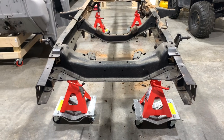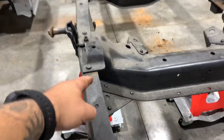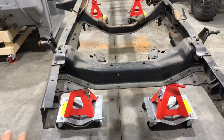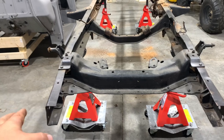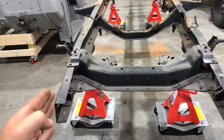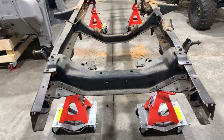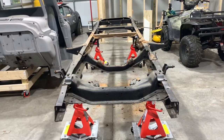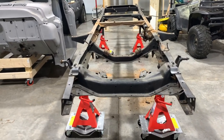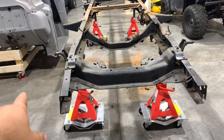Here's a better look at the chassis from the front. You can see that bend right there — it's only from here forward. The only thing that mounts up here is the front bumper. So I mean, if you really wanted to be sloppy, you could technically shim it. There's a bracket that comes off the bumper — you can shim it right there to make up for the space and it would be just fine, and no one would ever see that. But since we have just a plain raw chassis sitting on the floor of the shop, it's worth a few extra minutes of effort to try and straighten that out.